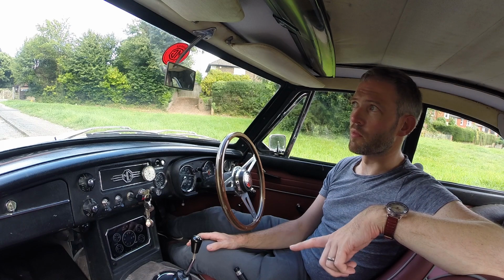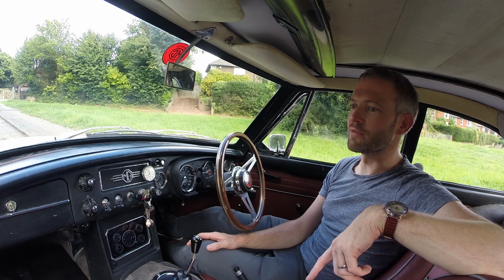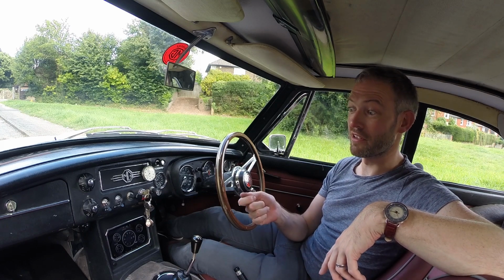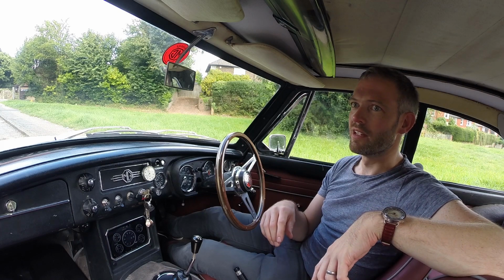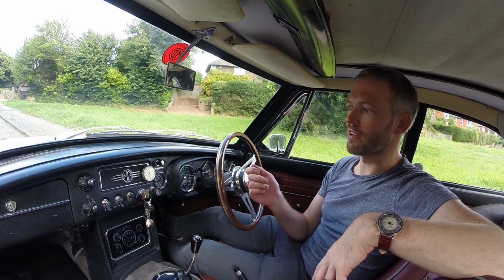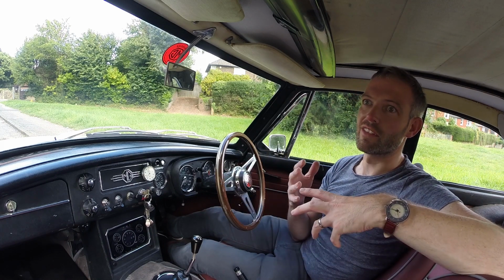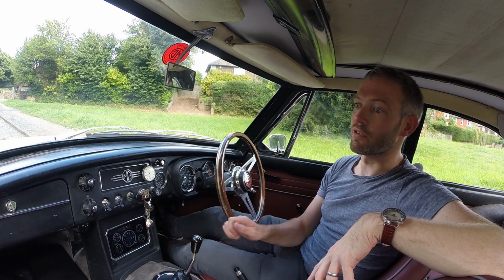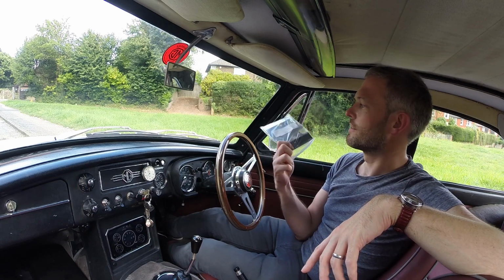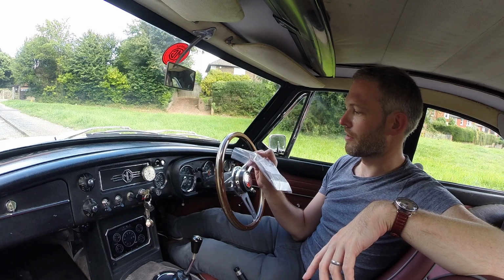This was actually a problem I had on the first proper YouTube video I made, where I was talking about the car for a while, and I went to take it for a drive, and I was trying to start it over and over again. It's a bit of a blooper reel part of that video right at the very end. But that was the cause. It wasn't because the car was bad at starting or anything like that. It was because the car had been driving, the heat had soaked into the inlet manifold, and the fuel just wasn't getting there. So I've had this sitting around in my parts pile for 5 years now.